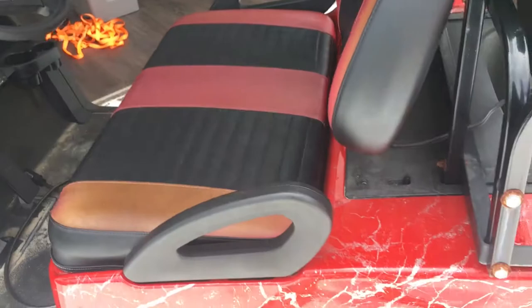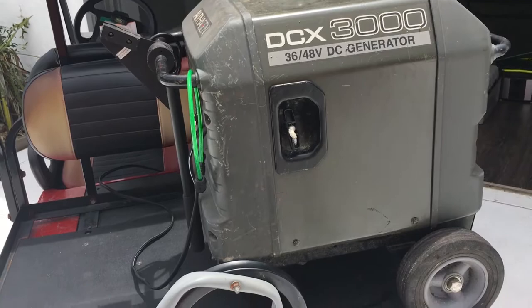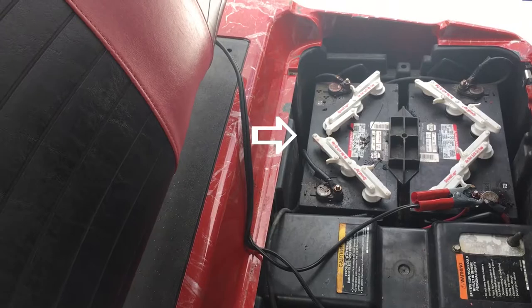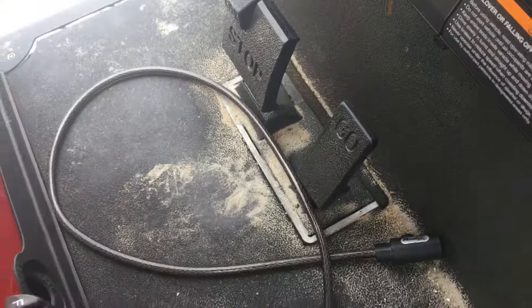This was a test to see if I can get my 48-volt electric golf cart to work off my 48-volt generator. In theory I believed it would work because this generator can supply 3,000 watts. It just so happens that I have a bad battery, so this cart's not going to go by itself. There are four 12-volt batteries and that one there is dead, running around 10 volts — I have a bad cell in the battery.